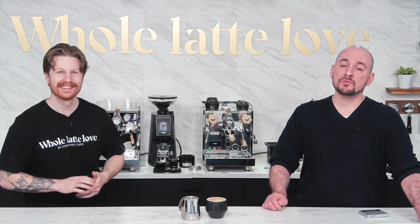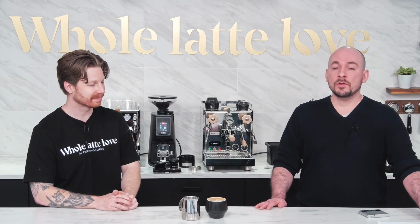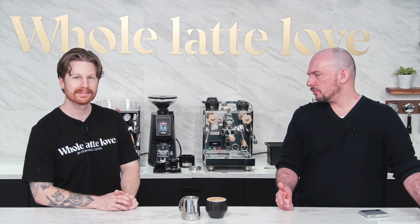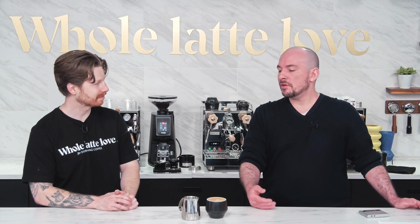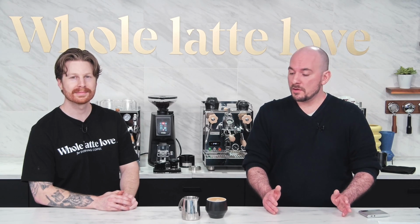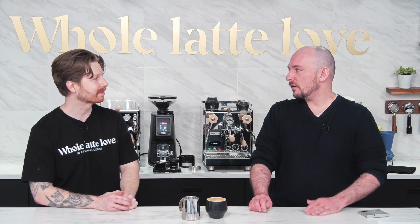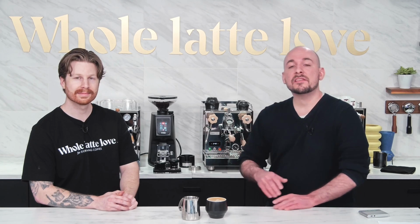So heat exchanger machines are really great for people who want to drink those milk drinks every single day, right? Oh, yeah. Because what you lack on a heat exchanger is obviously the extreme power of a dual boiler or the extreme precision. And so a single boiler machine, for instance, can get you that brew temperature precision that you want, but you can't froth all the time. Exactly. So the heat exchanger is nicely balanced between the two. But I would say that this is definitely the kind of machine that you would get if you enjoy milk drinks every day, and likely too if maybe you're going to be brewing with blends, for example, and you're going to have a coffee that's going to be fairly consistent, because that brew temperature control is obviously going to need to be balanced against your steam pressure.